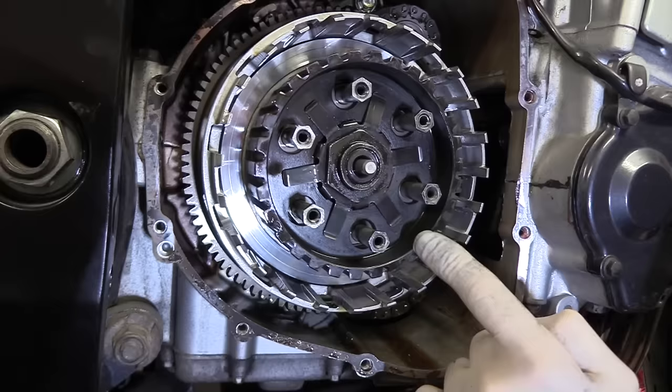Once you're happy that that's all okay, do the same with the outside, because again, the friction plates, they live, most of them, all except one. Let's get it in. There. They live in there. So again, as this thing is torque, as it's twisting all the time, as a clutch does, then these outer teeth here are bearing against these slots here. Now, if you look closely down inside, you might be able to see, perhaps in here, there are these little shiny marks. And these little polished sections are where the teeth from the plates have just notched against them. Now, you're going to get that.